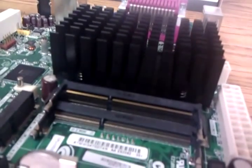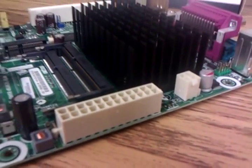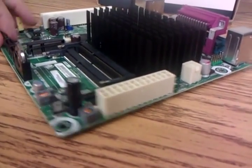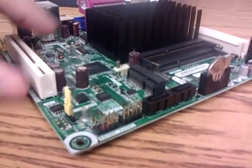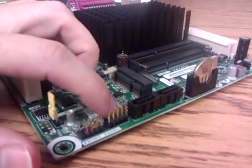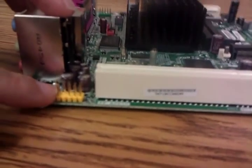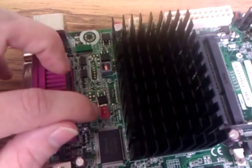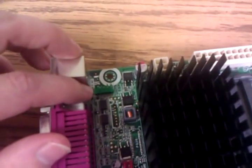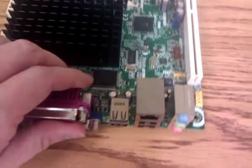but it does handle 25 to 35 megabytes a second just fine. Two SATA ports. Takes DDR3 laptop RAM. Uses a standard power supply — don't have to do anything funny with that, no silly little shuttle power supplies. One internal USB right here. Standard audio jack. Optical audio jack. Optional system fan. An internal serial port if necessary. This last one here is for flashing the BIOS via USB.